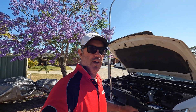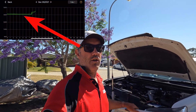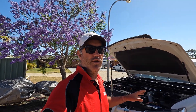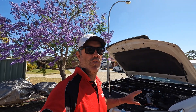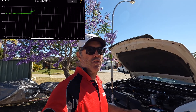Another thing I found with the lithium battery compared to lead acid is it holds its voltage all the way through, so it never gets below 13 volts until it's dead empty. Unlike a lead acid battery that'll work its way down from close to 13V right down to 11.5V at about a 30-degree angle on the graph - the lithium battery just stays above 13V the whole time, which is much more efficient: higher voltage, less current needed.